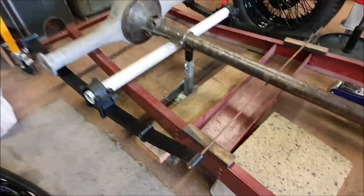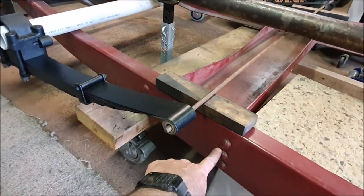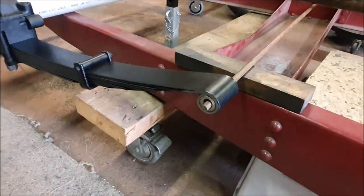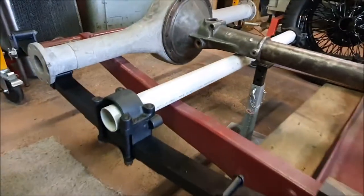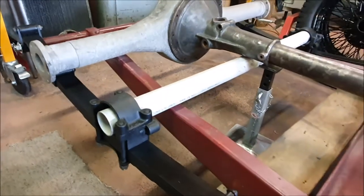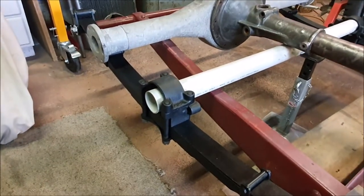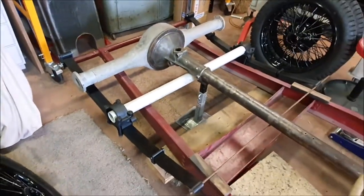I've put in some shorter blocks because from memory the shackle pin is on the centerline of these rivets, which is the centerline of the chassis, and that puts the top of the springs about there. I've got some side-on pictures I can compare. I was worried the trunnion block is too low, but I'm forgetting that these springs aren't loaded — when the weight is on them they'll flatten quite a bit, which will actually lift them up the required amount. At least that's what I'm hoping.